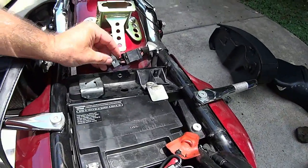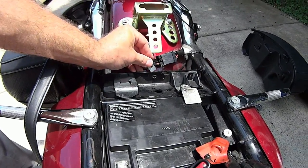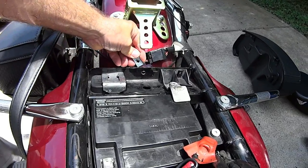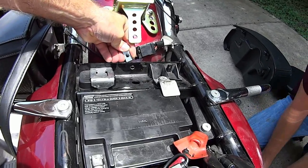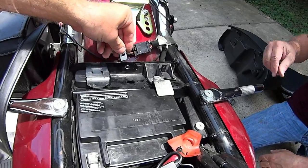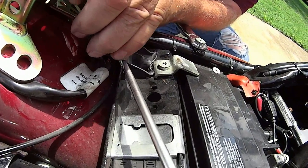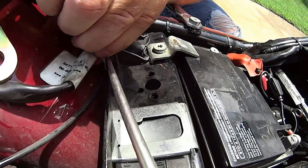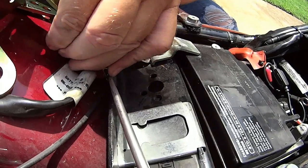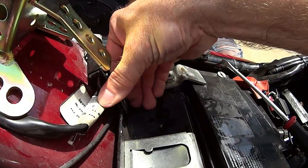With the kit comes this little clip right here. See how the little locking teeth are there - that's where the bolt engages for threads. This comes on here and has to snap in behind this. It's a little difficult to spread that and lock it on with a camera in one hand. What you do is get a flat screwdriver, spread that out, and slide down and let it lock in place. Basically take the screwdriver right inside that, hold it, and just flex the screwdriver a little bit to spread it just enough.